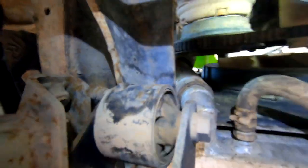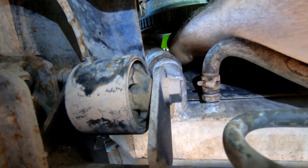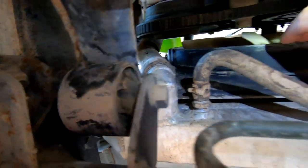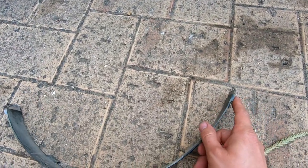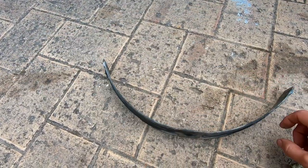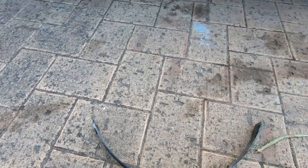These ends are just a push fit — it pushes up at one side and pushes up at the other side. It's retained by one clip there and one clip there. Basically what you do is unclip that, unclip that, and then the whole lower section just pulls out. Now that the lower section's off you can see that as this bit goes upwards it will actually clear the fan. With that section in it would be hard up against the fan and you'd either damage the fan or smash the crap out of it. Looking at that, I think once it's raised two inches we should have no dramas.